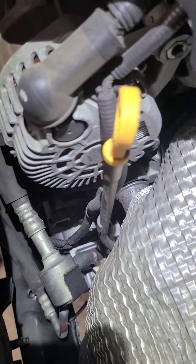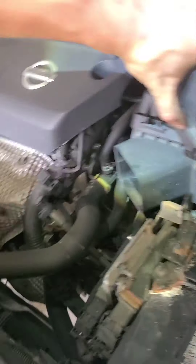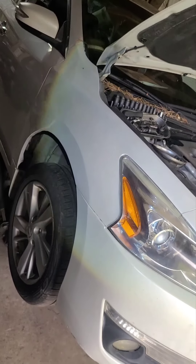It's a 17 millimeter on top. Put your plate back on, now you can recharge it with Freon. Put your bottom line in first, then put your top line in, then connect your electrical connector, then put your air duct back in. Go ahead and recharge it with the right amount of Freon so you can see if anything's leaking. Then put your shield back on and make sure there are no leaks. This is a 2013 Nissan Altima AC compressor — thank you for watching, don't forget to subscribe, bye.